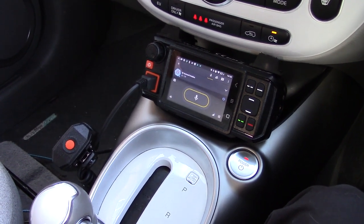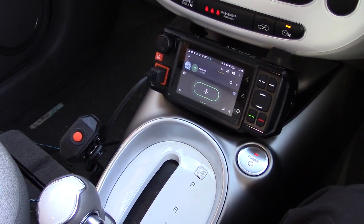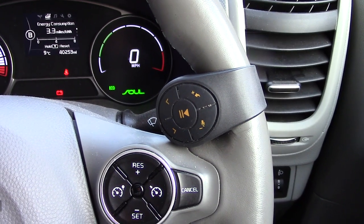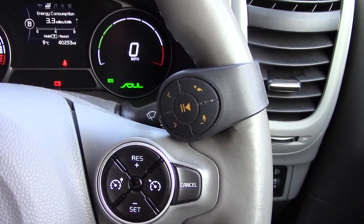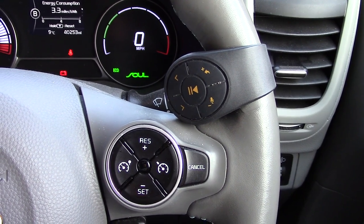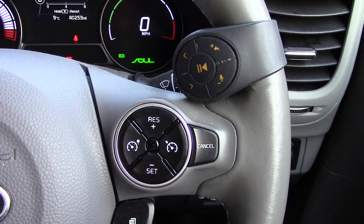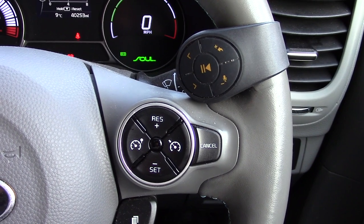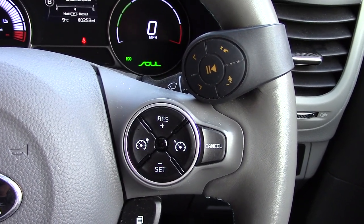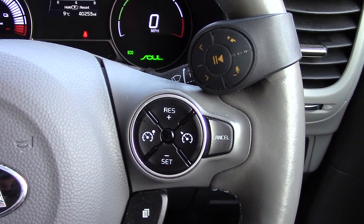There's the finished installation with the microphone attached. If you don't want to use the handheld fist microphone, you could use a Bluetooth button. I have one installed here on the steering wheel, and there are two different styles available — both featured in the link below. That way you can use the unit hands-free. The W2 has a built-in microphone so you can disconnect the fist mic; there's a small microphone in the radio itself that's more than adequate for picking up your voice in the car. You can control the PTT by pressing the central button of the Bluetooth button, which makes it much safer when driving.